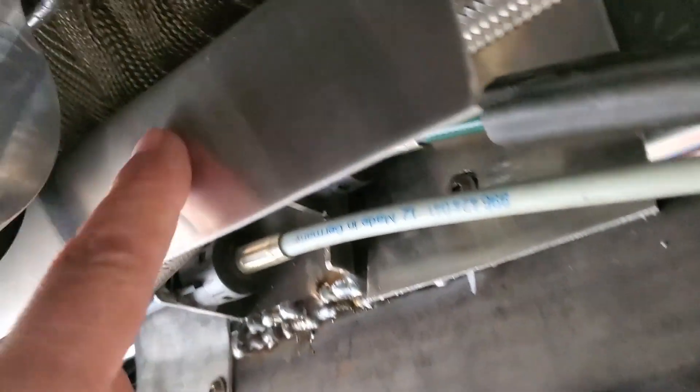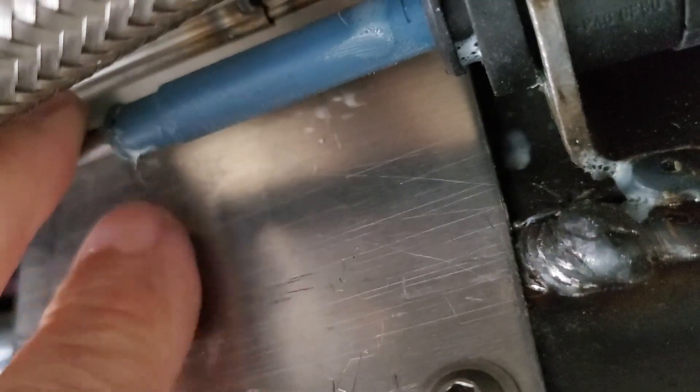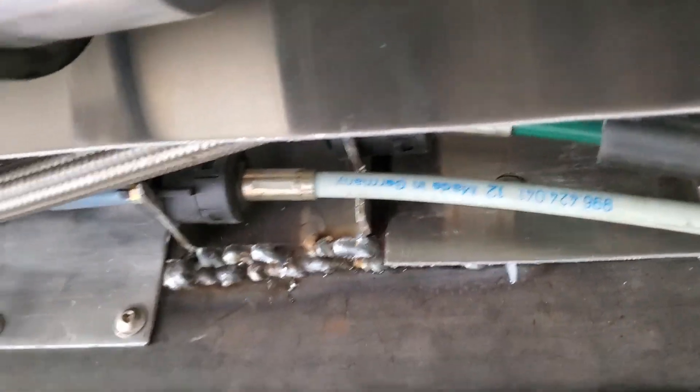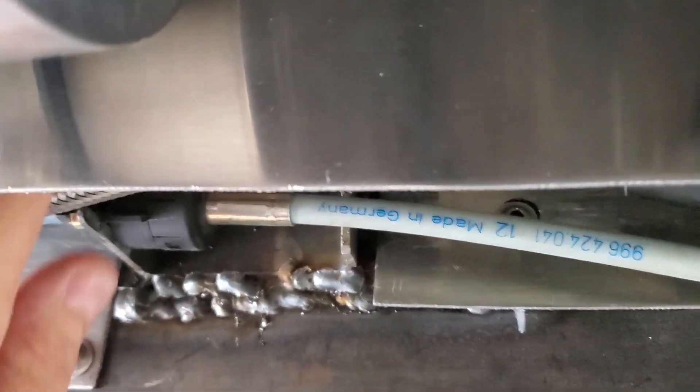The other thing I did was I made a heat shield, because this is the exhaust down here — it's DEI wrapped, as you can see, in the titanium, and it's actually double wrapped. But it did come pretty close to here where these shafts actually come in, and could potentially be a problem if the material in here got warmed up and was preventing the gear shift lever from going in and out. So I made this bracket up this morning and bolted it into the frame so it's not gonna rattle or make any sound, but should give pretty good heat shielding from the exhaust.